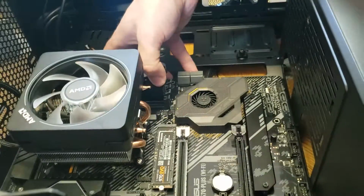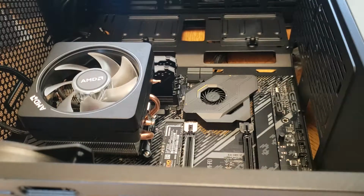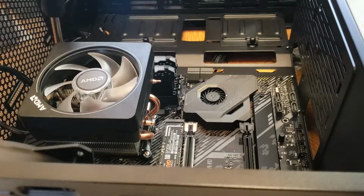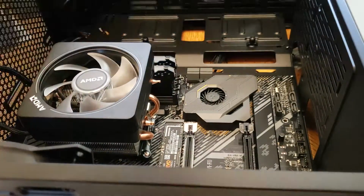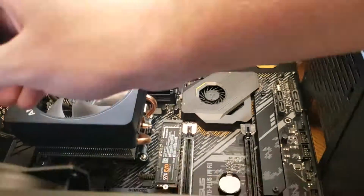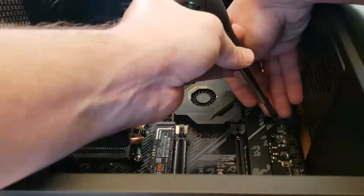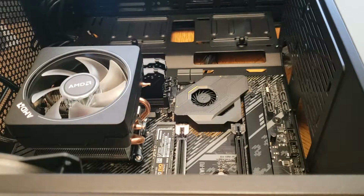All right, so we are gonna go real quick through here. We're gonna place the motherboard down, screw down all the pieces. In this particular case, we did have standoff screws that need to be put in prior to this. Just on this particular motherboard, I gave you a small diagram on the actual base of it, and so you can see what size motherboard you have, and then adjust where the screws go from there.